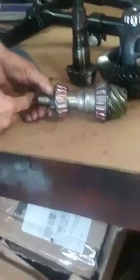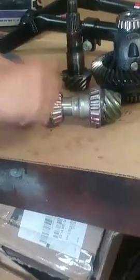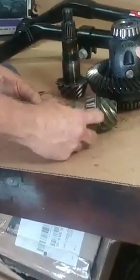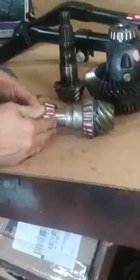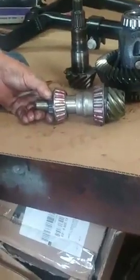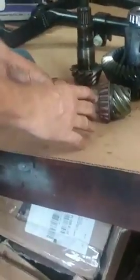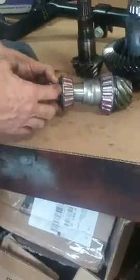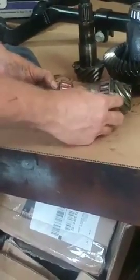So what happens is we drive this in place with an impact or a torque wrench. We bring it in and we crush this sleeve down so it bottoms out on this bearing race here, bottoms out on that bearing race. That gives you the bottom end of your torque specs on a pinion. After that's done, then you come in with the nut and you tighten it down. So basically what happens here, this bearing does not move. Once it's in there, it does not move.